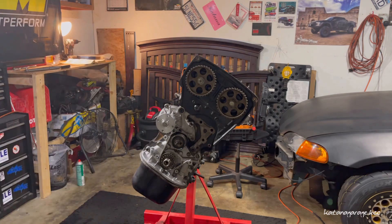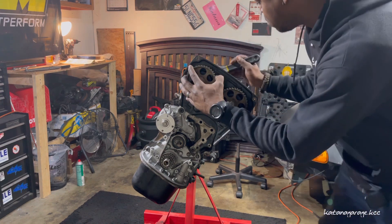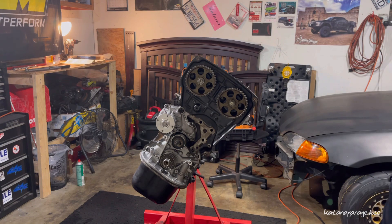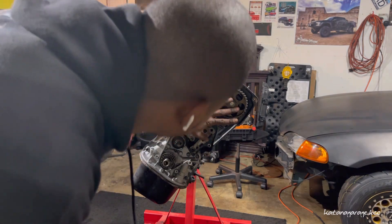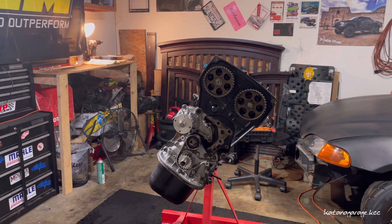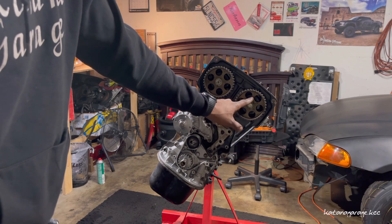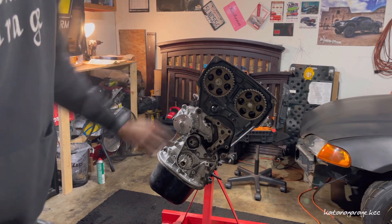Re-check my timing. I know my notch here needs to be lined up — that's lined up, that's lined up, so I'm good there. This one's off a little bit, I'm going to set it back. I know I'm not bending any valves because my pistons are all the way down. Now that I know I'm done torquing all my cams, my cams are set and ready, my timing is set on the top end. Let's go ahead and reset my timing on the bottom end. Your intake cam sprocket notch is lined up to the notch on the upper timing case; your exhaust cam sprocket notch is lined up to the notch on the upper timing case; the notches on the camshafts themselves are all clocked to their respective zones. Your crank sprocket notch is lined up to the notch on the oil pan. Timing marks verified.